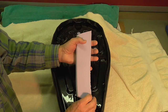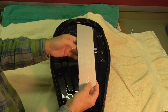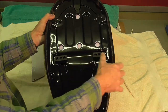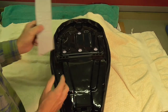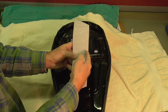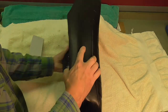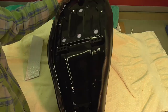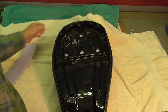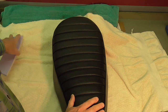I did make one adjustment from my original plan. I originally planned to install the carpet pad foam with the fiberglass facing down toward the pan, but I changed my mind and reversed it. You can see the carpet pad color right here. The reason I flipped it is that where I had cut the face material with an exacto knife in the previous segment, it allowed the pad to bend more easily around the corners, making a cleaner fit. So the fiberglass facing is now facing the original foam on the seat.